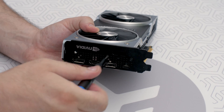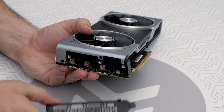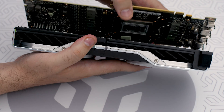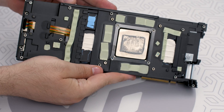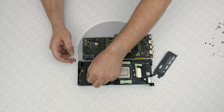There are different types of screws from one graphic card to another, so using an appropriate screwdriver is essential. You may or may not remove the IO plate, but if you do, the block installation will go smoother. Now remove the housing and don't forget to unplug the fan cables. Carefully detach the original stock cooler and double-check that you removed all screws.